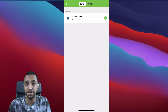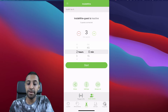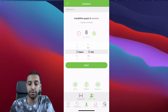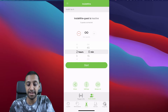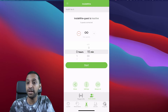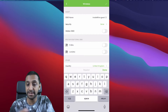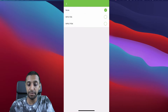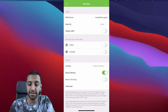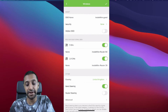This is great if you have kids and want downtime for devices. You have Guest Access — the guest network is currently inactive. You can set a maximum number of users up to 10 or unlimited, limit access to 15 minutes, click Start, or choose 'Always On'. In settings you can change the SSID, add security with WPA or WPA2 — there doesn't seem to be a WPA3 option — hide the SSID, and choose separate SSIDs for 2.4 GHz and 5 GHz.